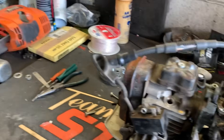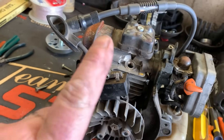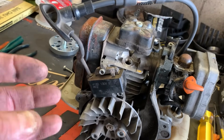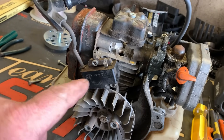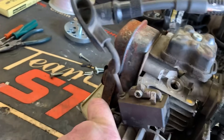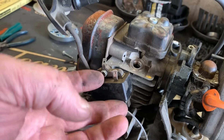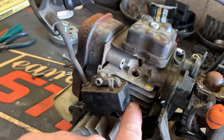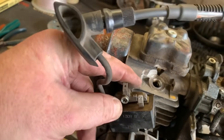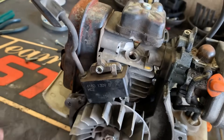Without a shadow of a doubt we can rule out anything else except the coil being bad — under one other circumstance. I'll post a link below to a video I did about a coil that would not fire, and the only thing keeping it from firing was corrosion between the coil and the engine block. I cleaned those mounting surfaces and it went to firing. Before you condemn a coil, I highly suggest taking it off, sanding where it mounts on the engine block and both sides where the screw attaches, to make sure you have a good solid mount with no corrosion — because corrosion does something to the magnetic flux lines and it just won't work.